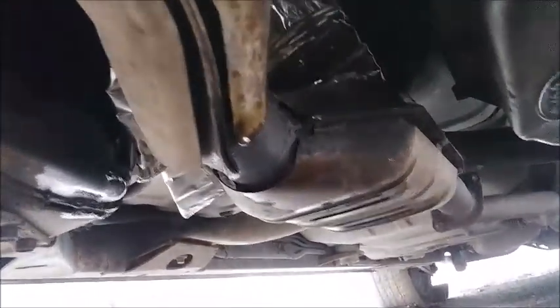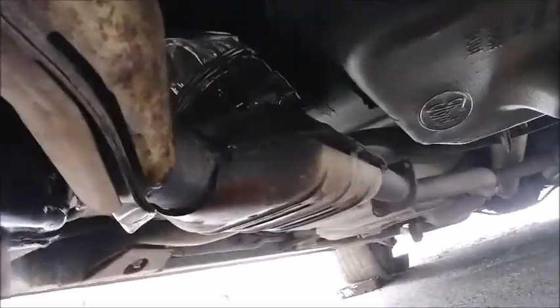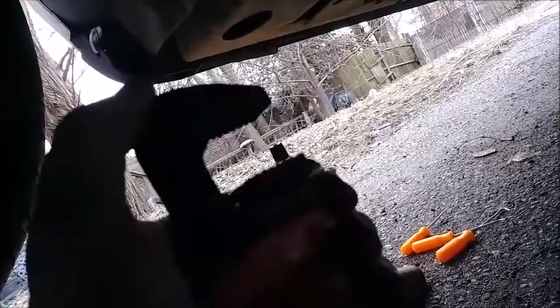Now, with the pipe wrench, for example, when we're facing this direction, if you want to loosen something, this upper jaw moves down. See how it kind of moves? It'll tilt towards. So as you are loosening in this direction, this thing is biting down into whatever object. And that's how pipe wrenches work.